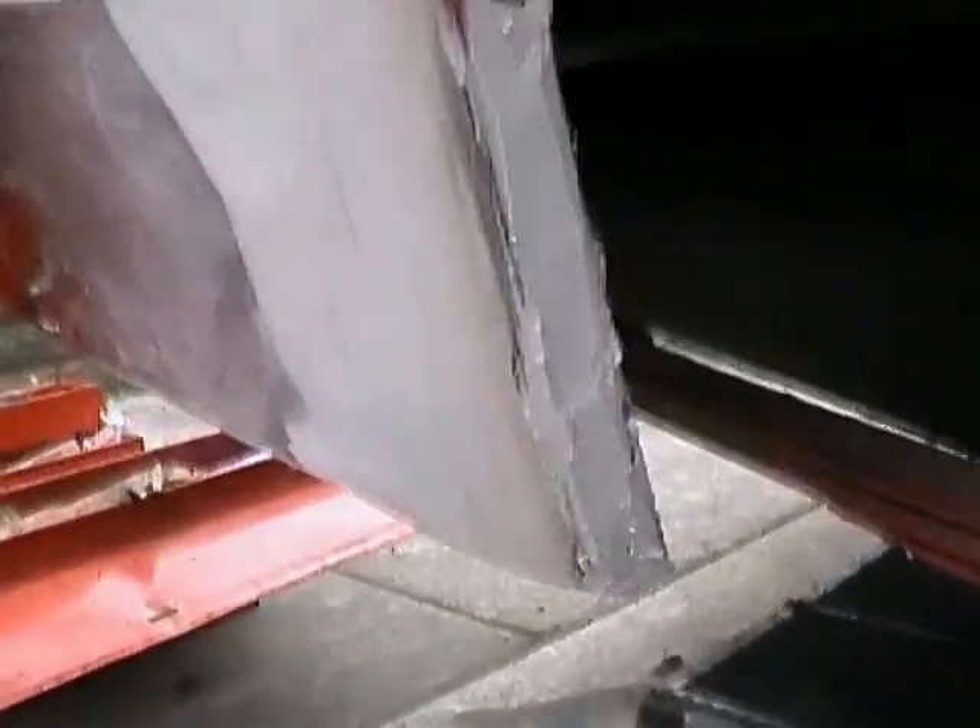Just been doing some work on these corner pieces of the back wheel arches here, just want to make them smooth so they look good. There's that one there and this one here. Waiting for them to dry now. There's sort of a glaze layer on this paint which makes it very awkward to rub down, so what we're going to do is rub down all this glaze part here to the proper paint, get all these bits off to prepare it ready for the respray.